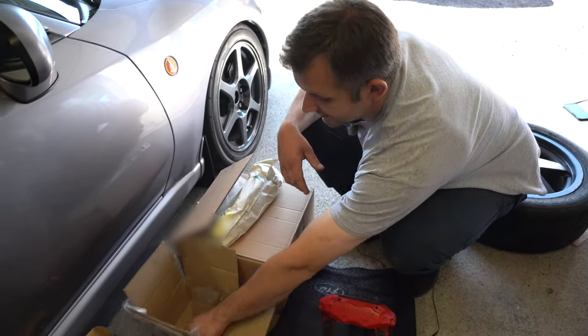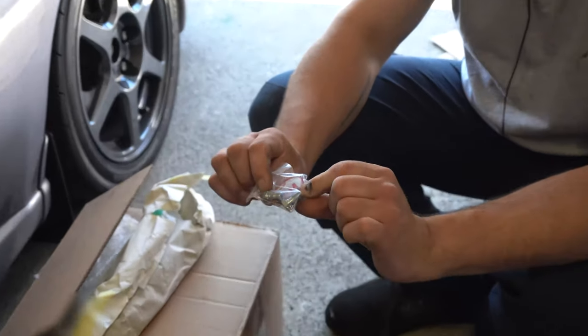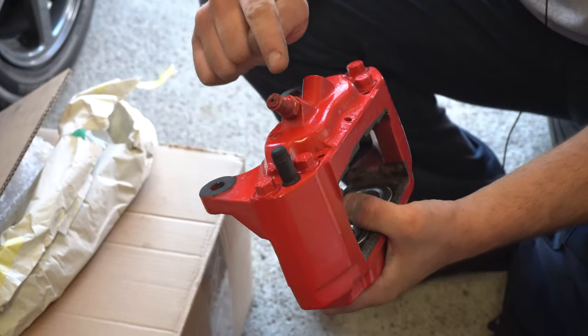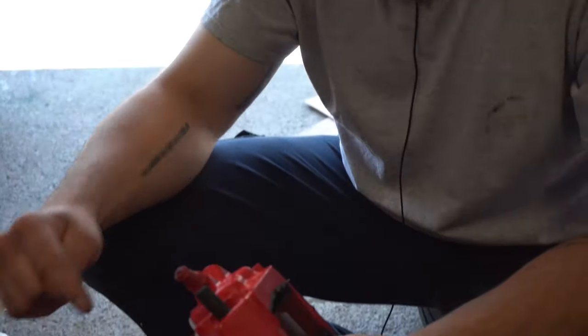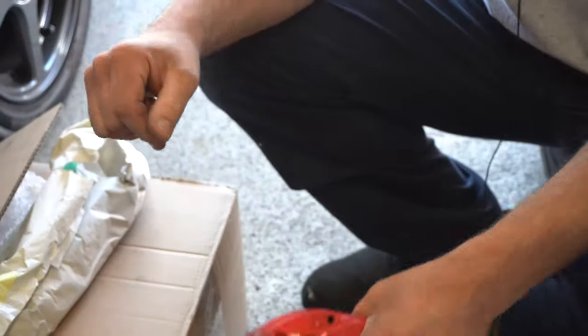I am going to attempt to connect the brake lines with standard banjo bolts instead of GTO brake lines. So we've essentially got braided FTO brake lines on here at the moment. And I'm fairly confident that they're going to work, provided that I convert them over to a banjo fitting rather than this weird fitting that FTO has as standard.